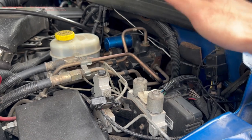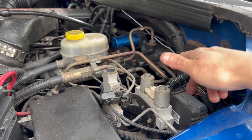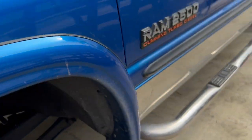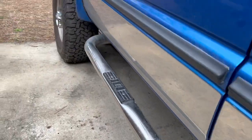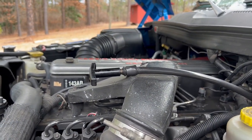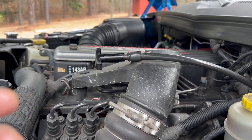There is a full-wheel ABS that looks different — that's for the '99 and newer ABS module. All this device programs is the ABS module. They said it has to have a Kelsey-Hayes ABS module and the ABS speed sensor needs to be mounted on the rear axle, not on the transfer case. If it has those two things, it might work. I went to O'Reilly's and ordered one — they said if it doesn't work I can return it.